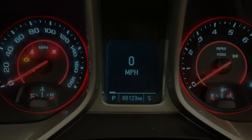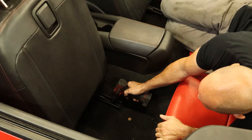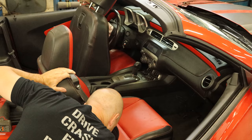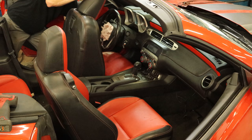We're not off to a good start — look at this genius that thinks the seats hold the drivetrain. But actually, before we disconnect the battery it's easy to move the seats around so we can unbolt them, because once we take the drivetrain out you have to jump the wires on the seat. So it's easier to do it now. We'll move them forward to unbolt them, center them over the tracks, put them all the way down so they're easier to maneuver and store. We're just going to leave them in the car — anything electrical we're going to use now.